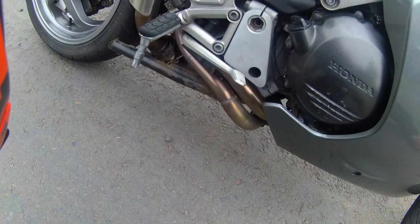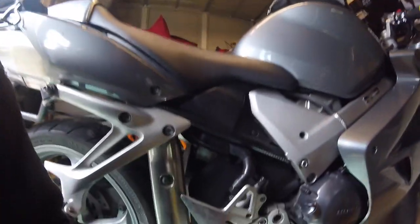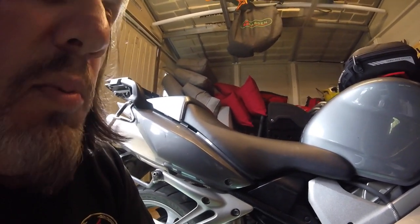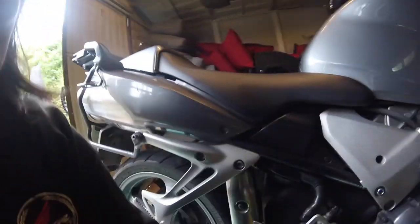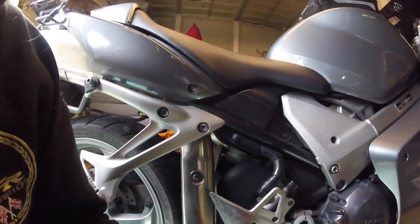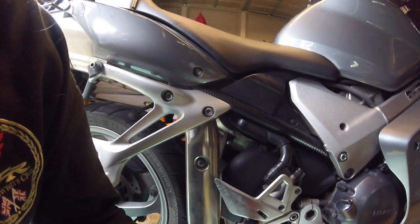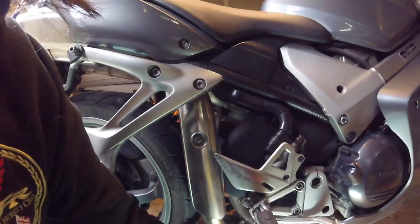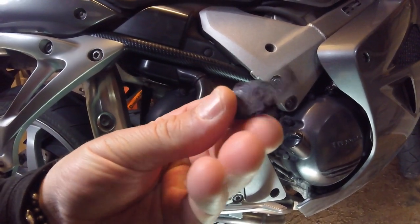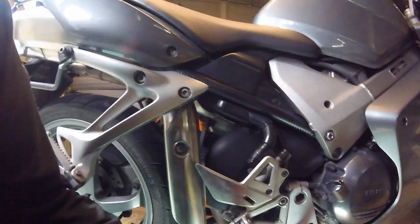It's doing the trick. We did the Wales run, used the Abro Steel on the exhaust and it held up perfect - we probably did about 300 miles around Wales and it was fine, it wasn't blowing. But coming back to it this weekend, a week later, the Abro Steel is starting to crack and peel off a bit. So obviously under the heat it's starting to break up.